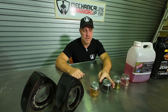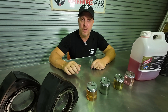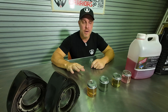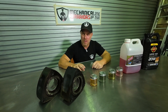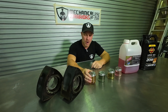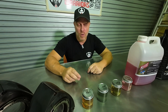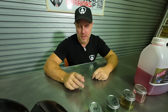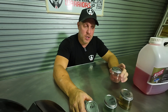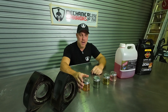As for Avgas, I haven't experimented too much with it myself, but being 100 octane I'd say you'd be safe around 20 psi — I wouldn't exceed much more than that, as it's only a couple of points higher than 98. However, I've had quite a lot of success using 98 in combination with methanol injection to counter the pre-detonation that happens with 98 fuel at higher boost.